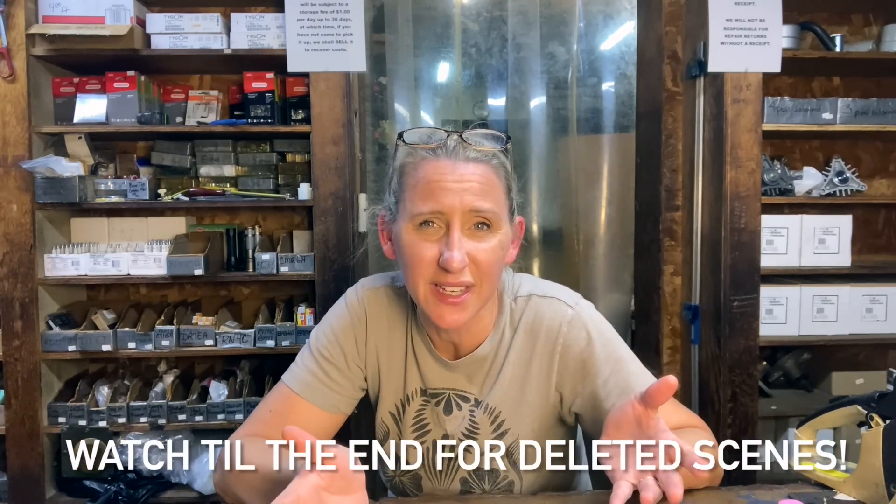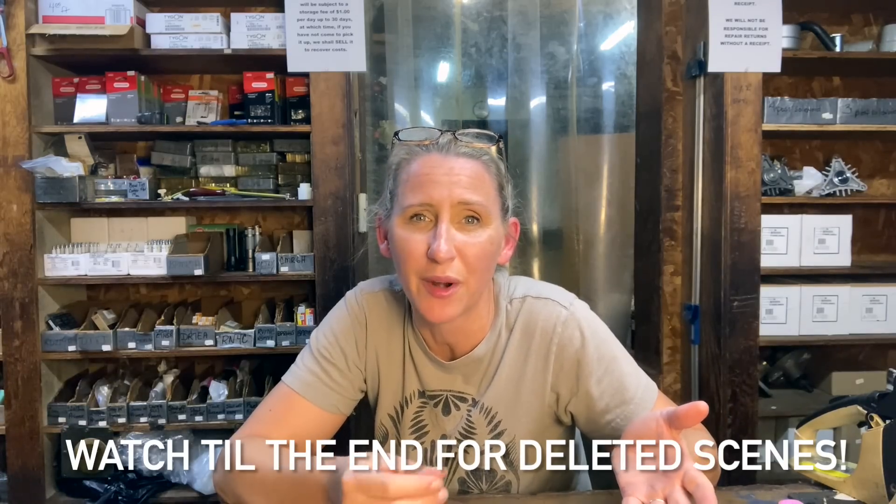I do have to admit that in 12 years of selling Echo, I have never once had to warranty a gear head with a grease plug. I don't know about these new ones yet, and the only ones I've ever had to replace were ones completely worn out from abuse by commercial users who never greased them. In the STIHLs, I've changed out tons of them — mostly because this town has a lot of STIHL people — but mostly it's been from abuse, not greasing them, and commercial use. So even without the plug, you're probably going to be able to keep your trimmer going for a long time, but I still don't understand why they would get rid of this one little extra thread and bolt to be able to grease your gear head.